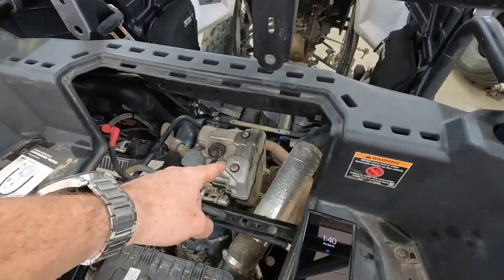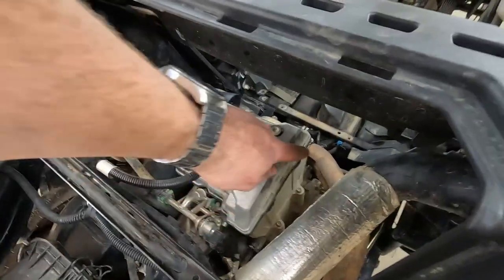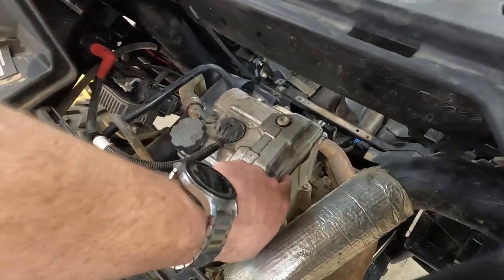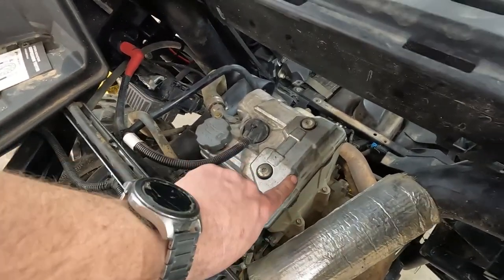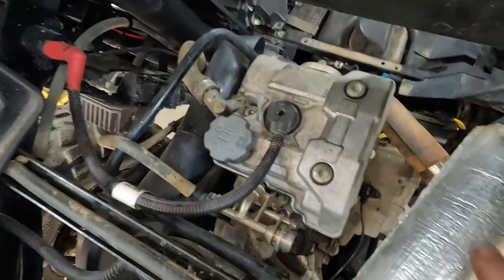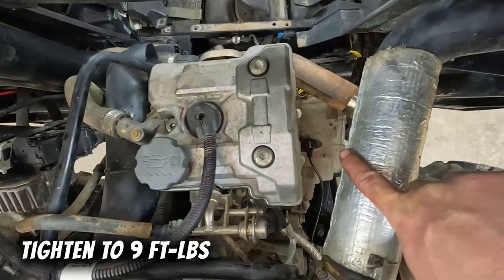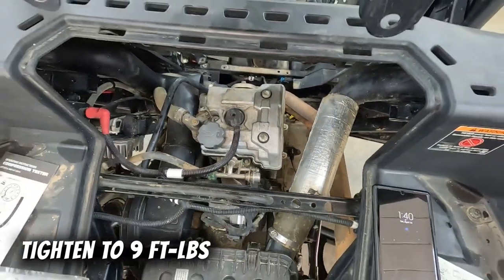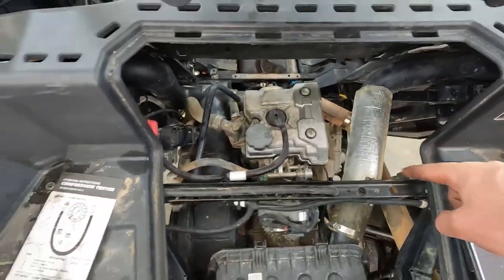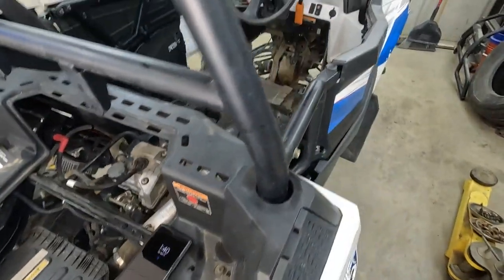I did have to reset the timing because I slipped and the sprocket came out of my hand. So remember what I showed you: just line up the exhaust marks on this cam with the top of the cylinder head, and the intake marks on this cam also lined up with the cylinder head. And don't forget your cam crankshaft position sensor — triangle pointed right to the bolt — that's how you make sure it's on TDC. So I got my tensioner in, my cam sensor in, everything in.